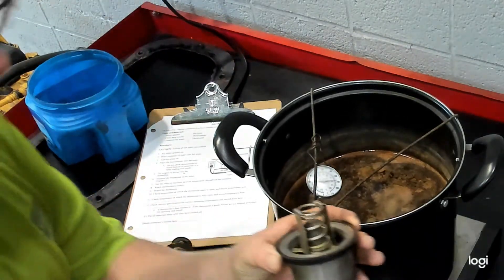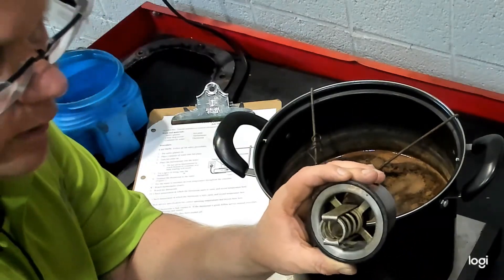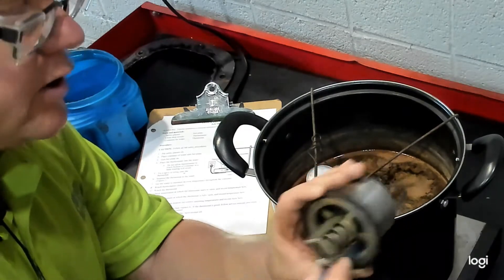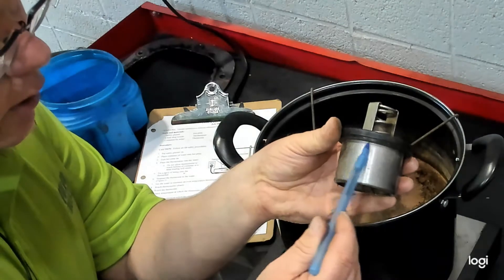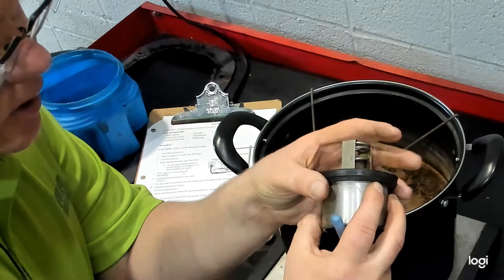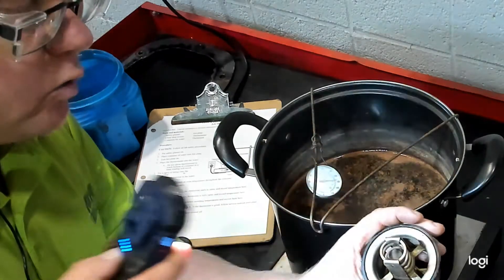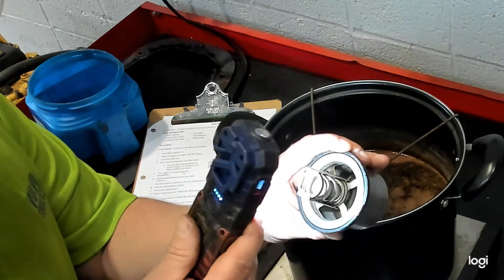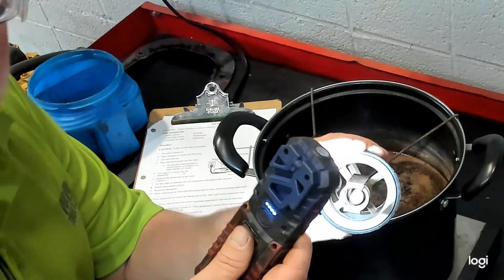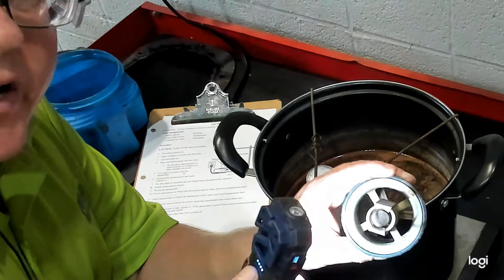The first style we see in a lot of our larger diesel engines and heavy trucks, and a lot of times people are unsure where this thermostat opens because it is open through the center of it — you can see I can stick the pen right through it. The opening is going to occur right here between the rubber band and the metal collar, which is actually going to move down when it heats up. Most thermostats will have their start-to-open temperature marked on them, and on this one it's a 190-degree thermostat, meaning it starts to open at 190 plus or minus two or three degrees.